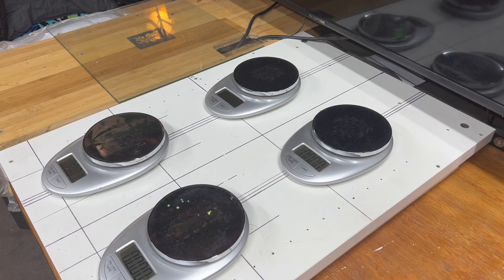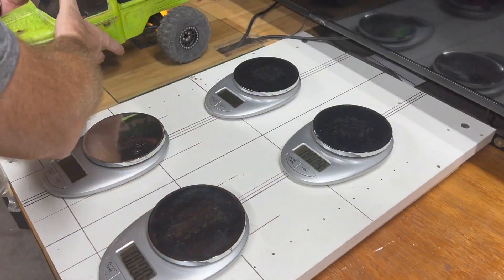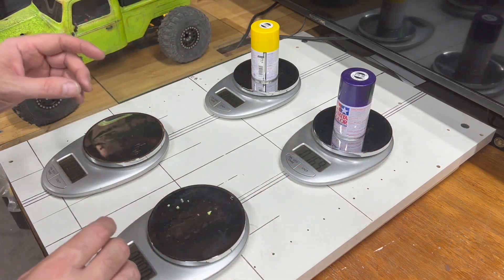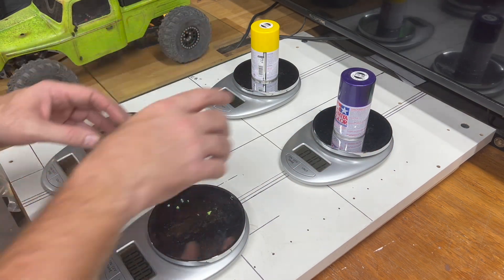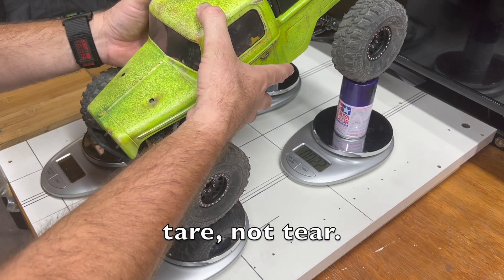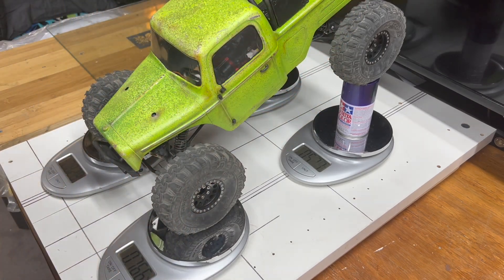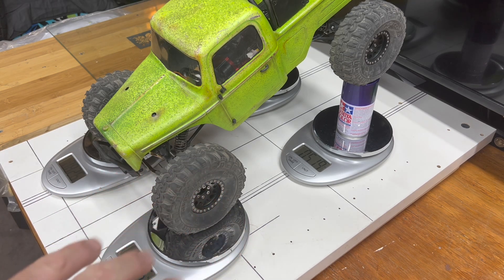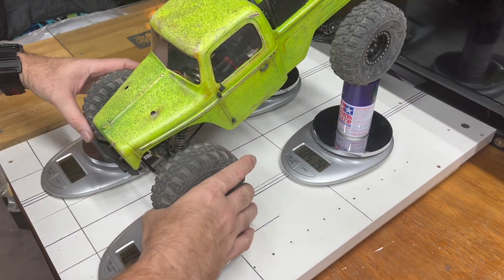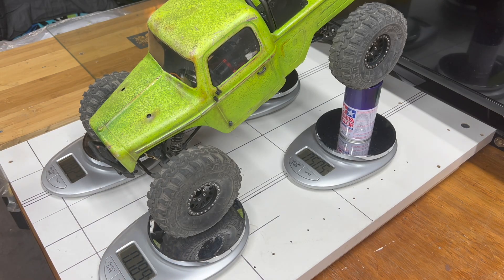Once I've written those numbers down, I now have to weigh the rig in what's called raised. I make sure I didn't move anything - everything looks good. You need two identical objects; these happen to be convenient, we know they're the same height, and these two are very close in weight - this one is 89 grams, this one is 101 - that doesn't matter because we're going to tare them out anyway. Position this like this, let it sit, and then write down these numbers.